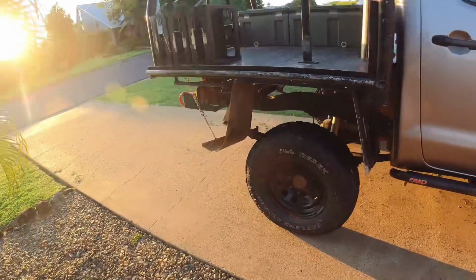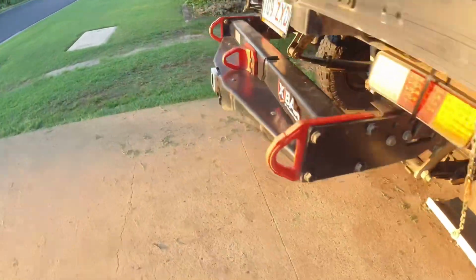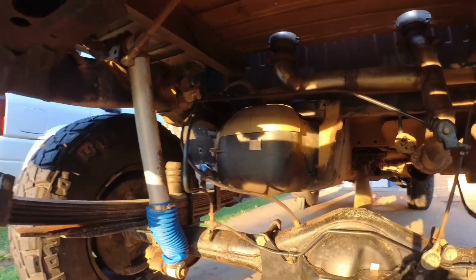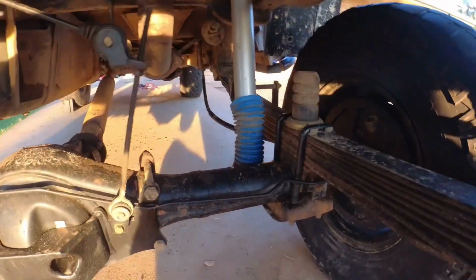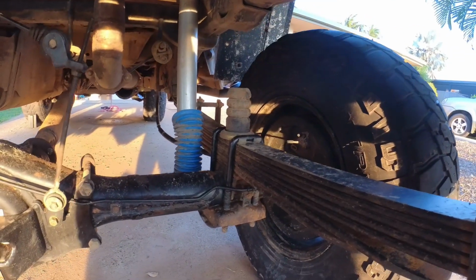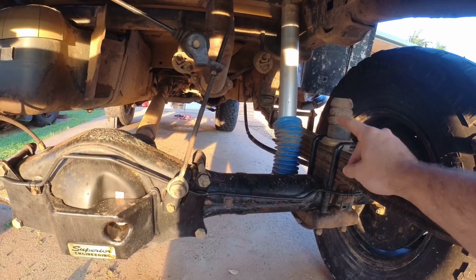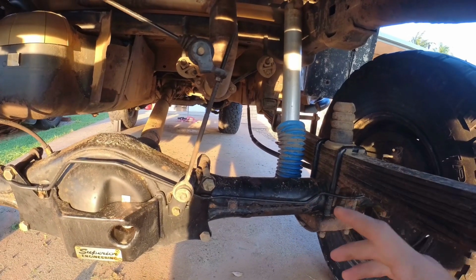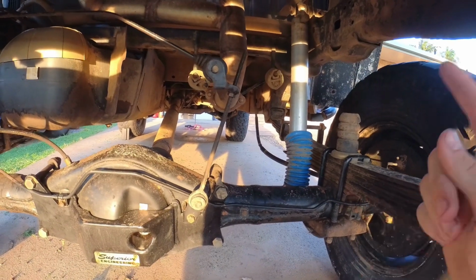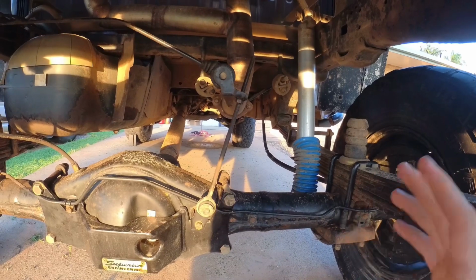And with the suspension, just talk about that. With the rear here, let me get under it. Now I've got these, just some progressive heavy duty bump stops that I got from Outback Armour. Got Superior Engineering, the 3-inch lift GU shocks. Patrol and Hilux shocks have the exact same dimensions for the eye pins, so you can put GU or GQ, whatever, Patrol shocks onto a Hilux.